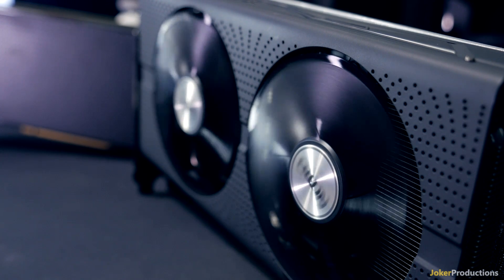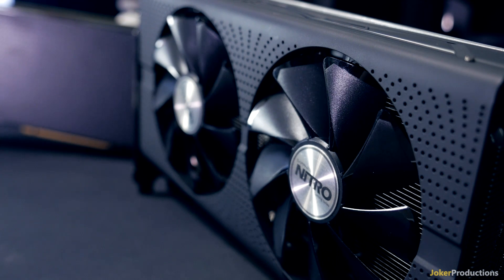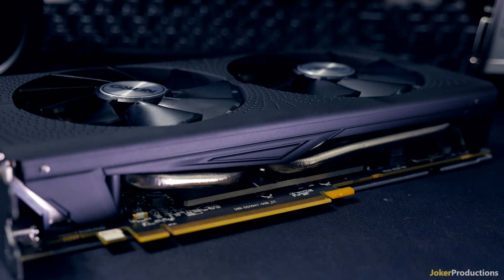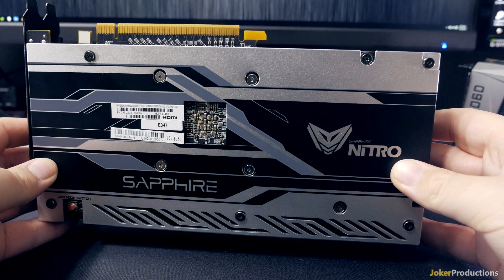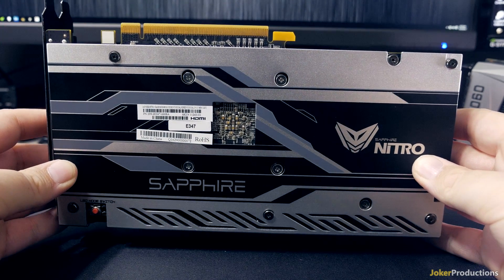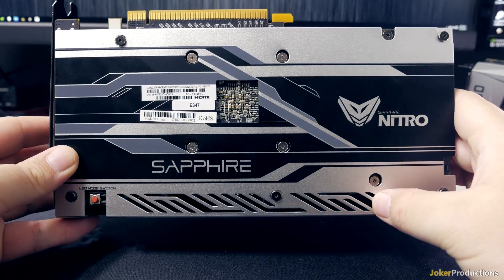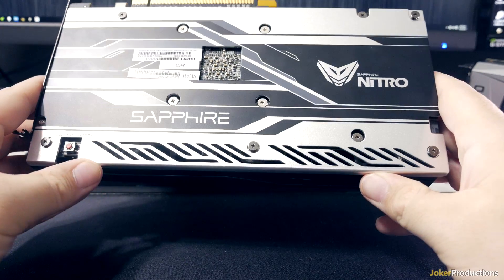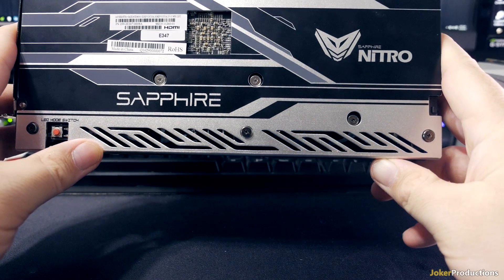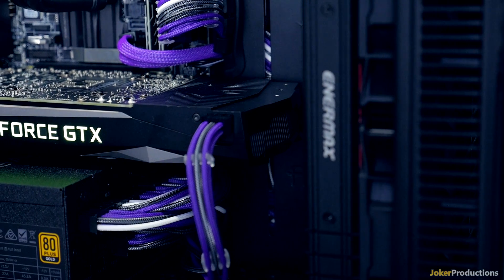You can see it does differ from the reference design — this is not using a blower style cooler. Instead, it has a dual fan intake, which blows across the radiator and then exhausts out the back of the PCB, where the backplate actually has two cutouts to help push that air out. So if you're running a large case with decent airflow, something like the Sapphire Nitro should run a lot cooler compared to something like a mini-ITX rig, where you may benefit more from a blower style cooler.